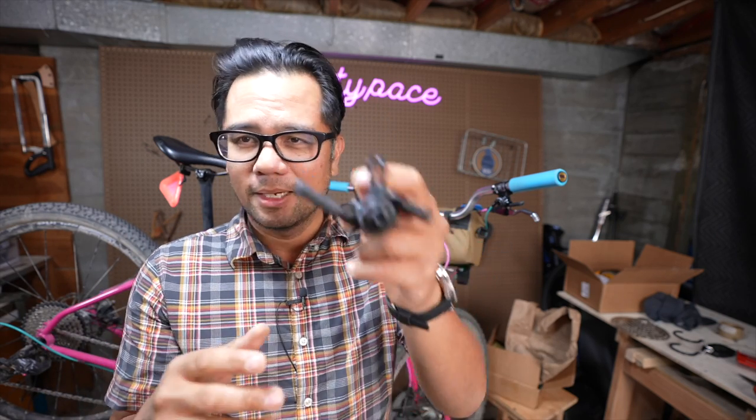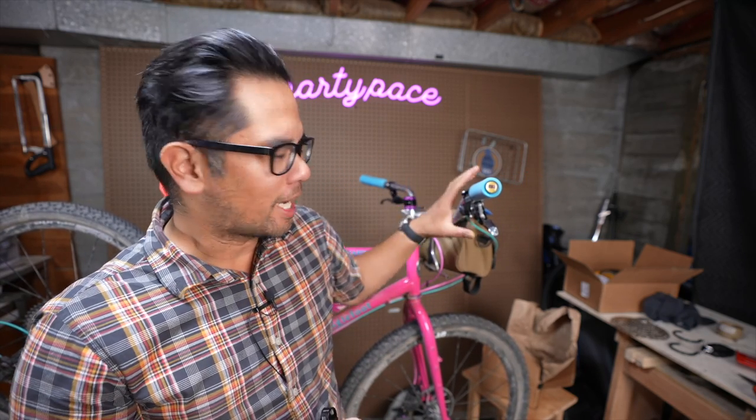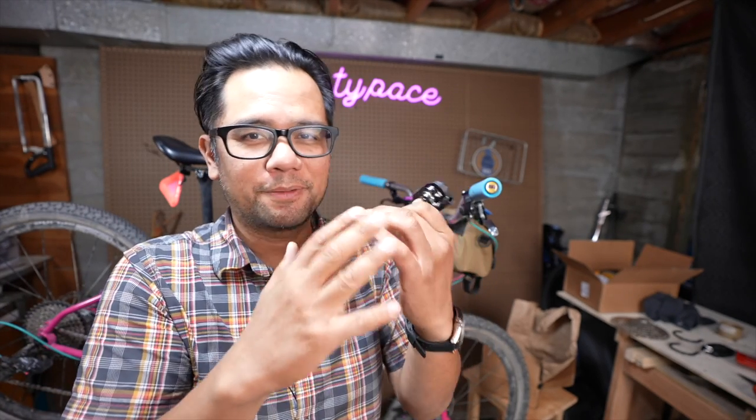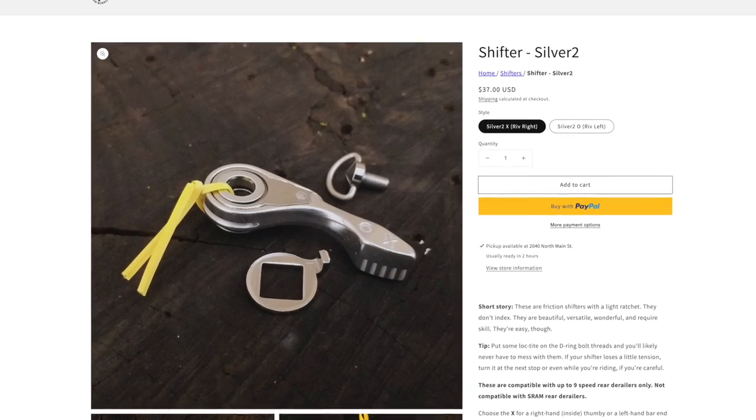In terms of options, MicroShift works great. The left shifter in a MicroShift pair actually has a little micro-ratchet in one direction, so it's actually a better friction shifter than the right shifter. When you set the right shifter to friction there's no ratchet — it's the strength of the top cap compressing everything that creates friction — but the front thumb shifter has a ratchet and works better, though only in friction mode. Rivendell also sells their Silver shifters and those work great. I've not tried one with an Eagle rear derailleur — I know it works with the Advent X. I may put an Eagle derailleur on the polyvalent just to see if it'll pull it through the whole range, but I suspect it won't — let me know in the comments if you've tried it.